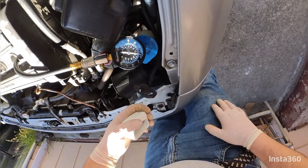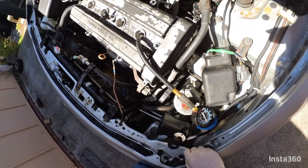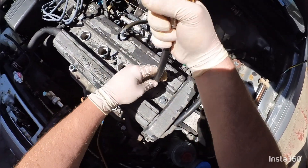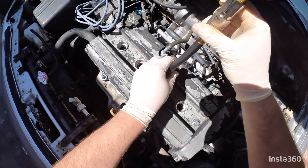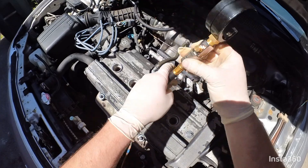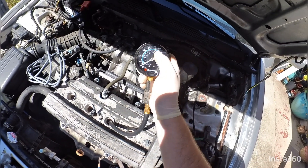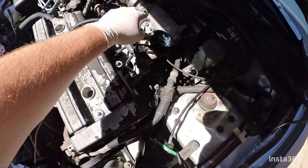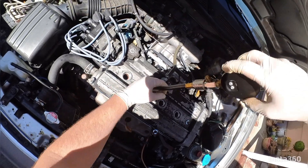We got 107 — then about 165 on that one. I cranked it a bit more and got about 180, so I know that cylinder is good. The last time I did it I got a higher reading of 180 — I might have cranked it one or two turns longer or tightened it slightly more. You don't want to crank it forever. Generally, if you're up around 150-180 you're probably good; if you're way down low, that's probably not so good. I got about 150-155 on that one.